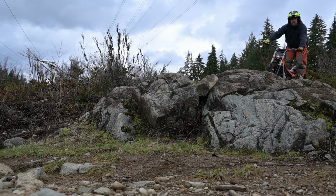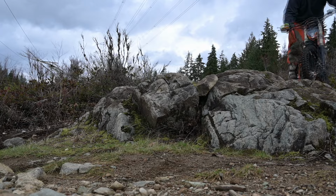50 hours on the bike, and you saw the oil was horrible looking, and we are riding in a very wet environment, the West Coast. It freaking rains here all the time, and I would just do the oil every 20-25 hours. It's not that hard to do, but the suspension feels fresh, the bike feels tight, it doesn't feel sloppy, suspension doesn't get aerated as much. So anyways, it's an amazing upgrade. The Tech suspension is already awesome out of the box.